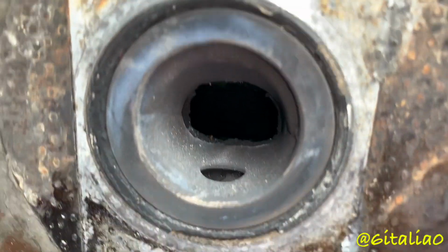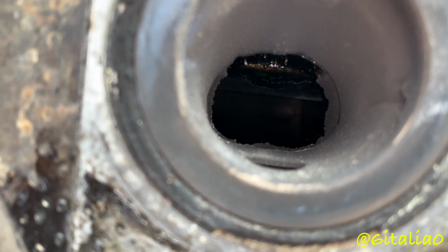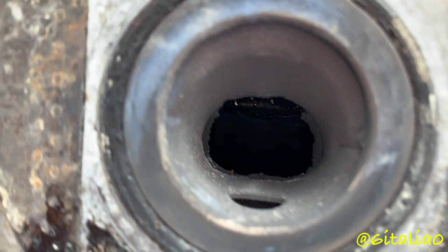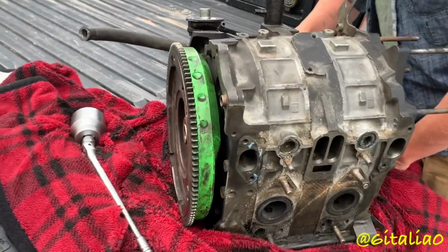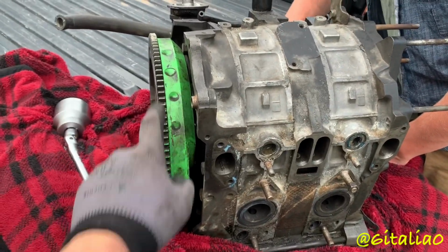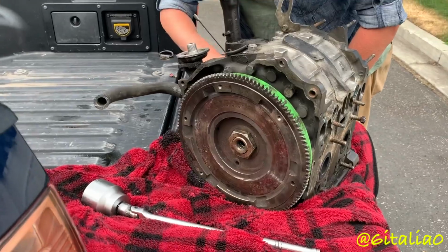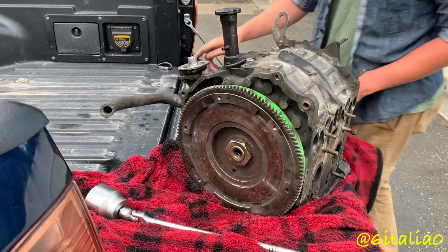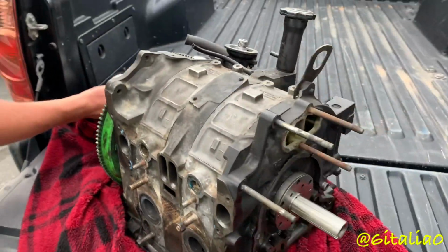So there's a coolant leak right there. All right, go ahead and stop. I'll keep going a little bit. It's really hard to turn. Or we're just gonna assume that it spun a bearing. Okay, so we spent a couple minutes just trying to turn it over a little bit. Was pretty hard, which was just bearing failure, but spun a little bit more and it spins freely.